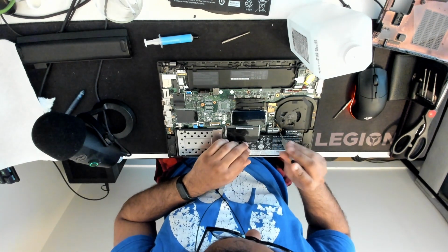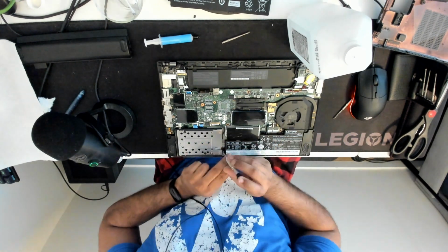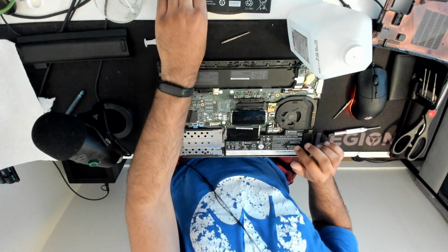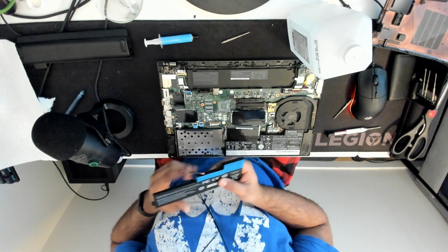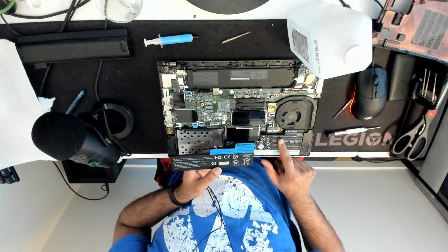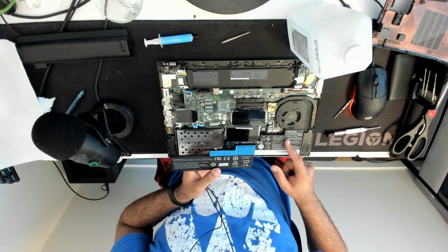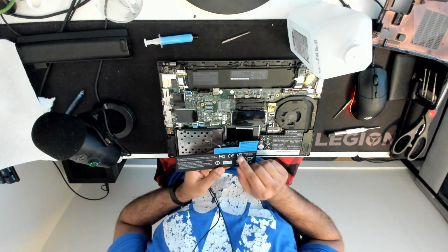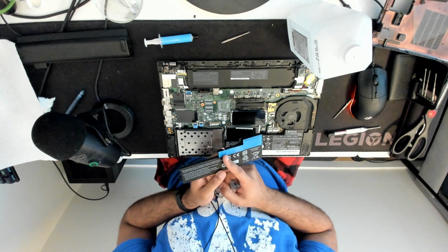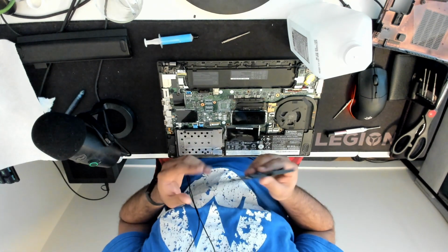So we want to unscrew things first. That's another screw over there. And now I'll just do one last sanity check of the reported voltages and current. So 11.46 volts at 2.09 amps. 11.4 volts at 2.1 amps. I think they just rounded, but it seems fine. It seems like it matches.